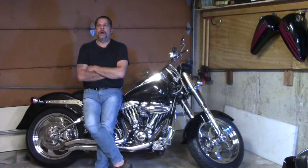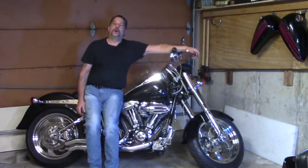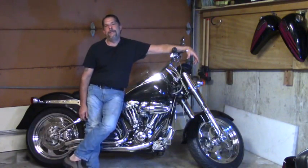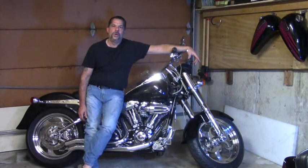If you are still running a conventional flooded battery with removable caps, which I haven't seen one in quite some time in a Harley now, make sure that the electrolyte level is full. Take the caps off and check all the cells. If you're running an AGM or a sealed style battery, don't let the age go too long. Again, I only wait about 4 years at best, and then I use the battery as a test battery. I don't like to depend on an old battery out on a long ride.